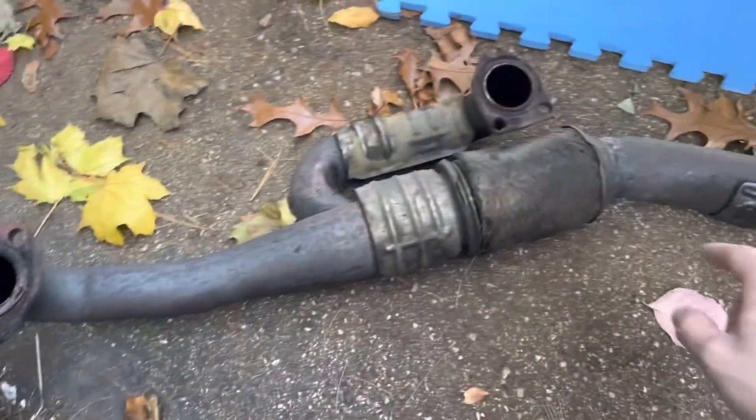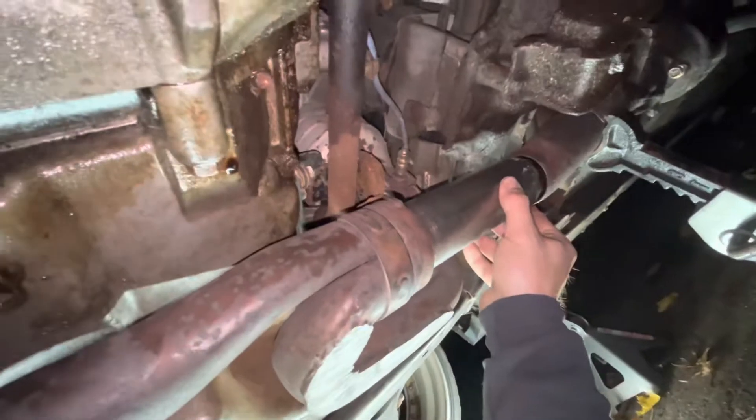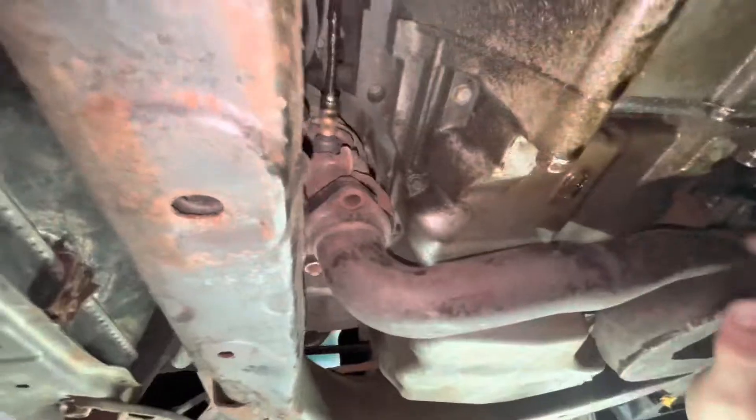I got a light so it's pretty much daytime under here. I got some new gaskets for these two. Instead of using a flex pipe — which I bought for about 60 bucks but it doesn't fit right — I have this piece of stainless that fits perfectly. Next I'm going to weld it here and here, then take it off the car to finish weld it. I've got this pushed up to get it risen and should probably sort the rear hang too.